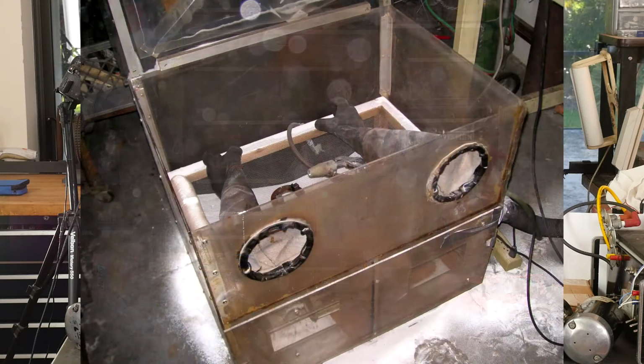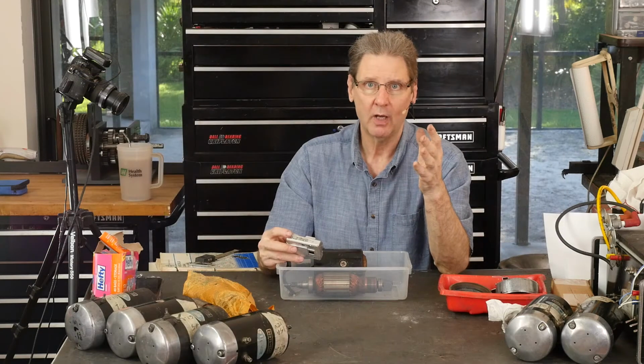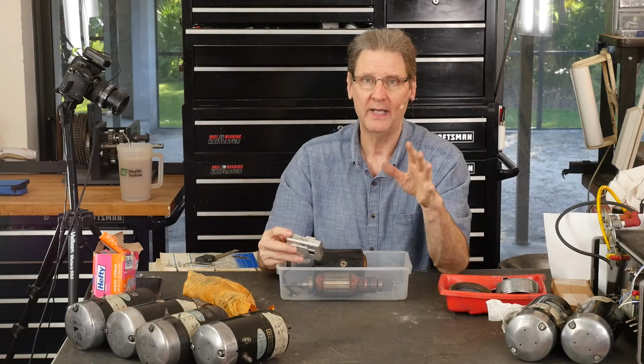Here's my homemade bead blaster. You might have seen it on the bead blasting the case shows. Clear plastic, mostly 1/4 inch on the sides, 3/8 on the top, piece of glass sheet glued on the top underneath because the plastic started to frost when the beads would hit it. I learned that lesson. The guts I got from Summit Air, not to be confused with Summit Racing in San Jose. I bought the gloves, paint can lids cut out to hold the gloves. The gun with a little slope thing in the bottom. I use not ultra fine, but very fine number 10 beads.